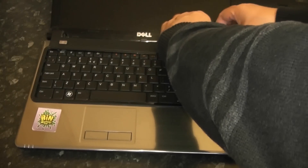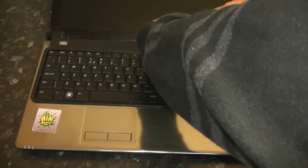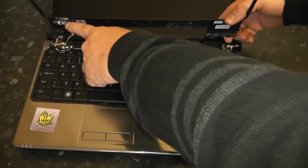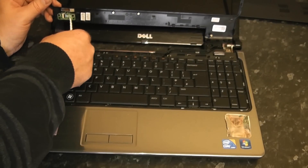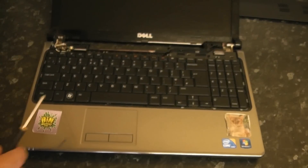You also want to be careful of the power button — there is a little ribbon underneath here, so don't go pulling around there too much or leaving any screwdrivers under there because you will break something. Just take it very easy, and once you've done that you'll see the little ribbon cable. This just needs to be detached — you can use your fingernail or a spudger, whatever you feel comfortable with. Once that's pinged off, put it to one side.